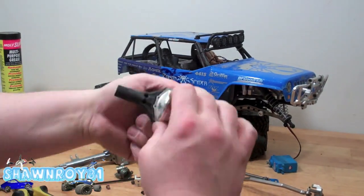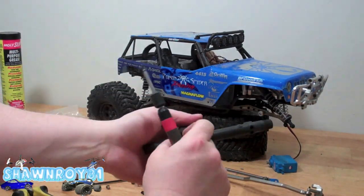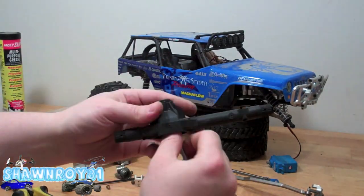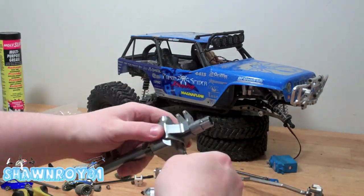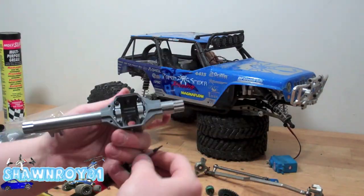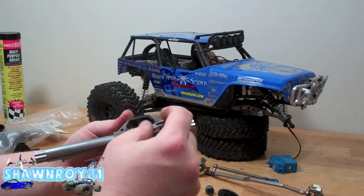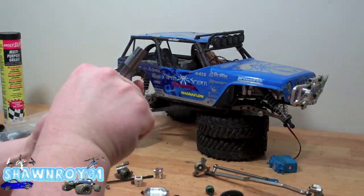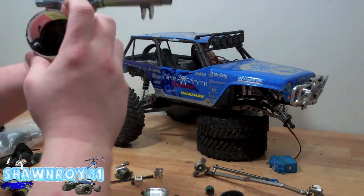Now for the diff assembly — those are four long screws, I took those off off camera. Now we have two retainers holding the diff. Got that out — you've got your pinion and your output shaft. So now we're gonna mount that into the new ones, so we're gonna remove that diff cover, which also has retainer pieces for the diff. Pull those out and get our bearings jammed in there.